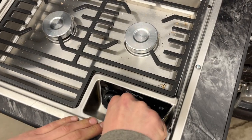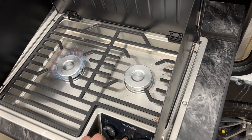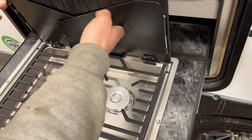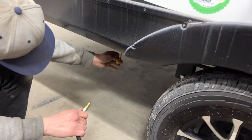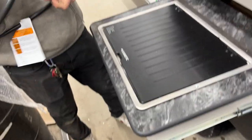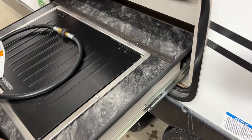Turn it over to light and then turn it with the igniter to fire it up. Once you're done, turn it off, let it cool down, put the wings back in, close it off, close off that propane valve, undo the collar, stick the dust cap back in, and undo it from the stove. Attach the hose to itself to make sure nothing gets inside, then store it back away.